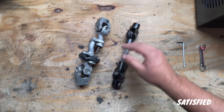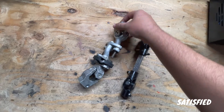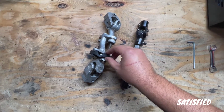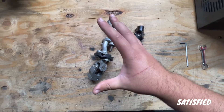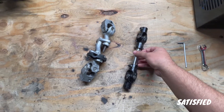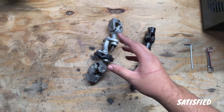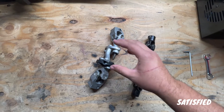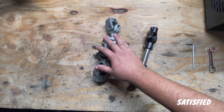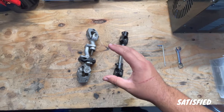That will give me a lot more space inside the engine bay and also a lot more clearance. Now as you can see from the stock one versus the Condor Speed Shop coupler — the stock one has a lot of these little kinks, and most of these kinks are just bushings for it to flex, so you still have a little bit of flexibility in the steering shaft. Compared to this one, it's just direct. With the new one you have dual joints from top to bottom, same thing with the stock one, but with the stock one over time there's a lot of flexibility. A lot of it tends to flex and there are companies that make bushings to either shorten it or replace the bushing to make it sturdier, but there's also a different option — the Condor Speed Shop coupler.